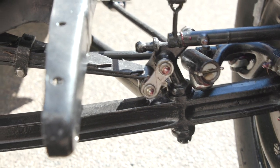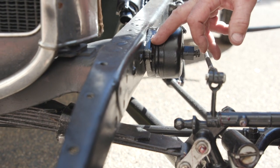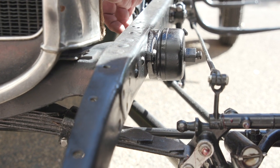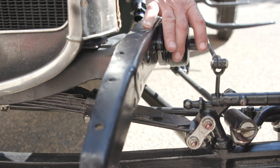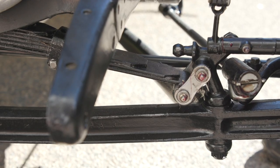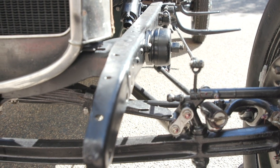You mentioned you have a shock mount? Yeah, so these are the shocks. Tim Johnstone had shocks rebuilt for me. These are the '31 shocks, which are a little wider on the bracket. And so you just run a bolt through the opposite side of the frame. And then that holds this shock unit itself in place. And then we have an arm that comes off and it ties into this ball down here. And so we got new shocks all the way around, and it does make a huge difference, I've seen in my other cars that I've had.